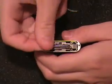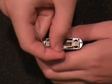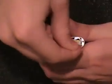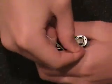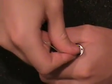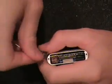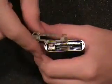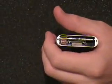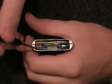Now grab an ordinary household paper clip. You want to bend the metal clips out of the groove they're in — they sit in a little groove in the aluminum case. Simply get the metal clip out of the grooves. That one came out really easily, but in most cases it will not. Go through all four corners and pull out the metal clip that way.